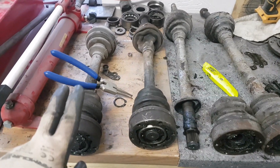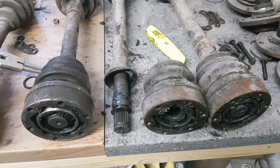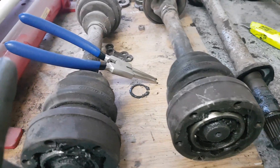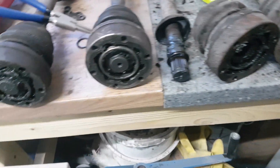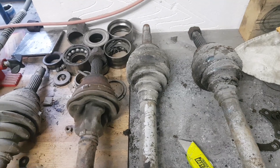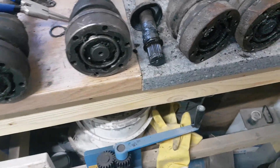These are the front two and these are the rear two. I've harvested those off the back of the old air diff. At the end of the driveshaft there's a little circlip - get the pliers on that, take the circlip off, and basically the whole CV unit just pops straight off. Out of all four driveshafts, three CV units have got clunks in them, so we're going to replace all four. The other end ones are nice and tight, don't seem to have anything loose, but these ones you can definitely hear a clunk as you're turning it.